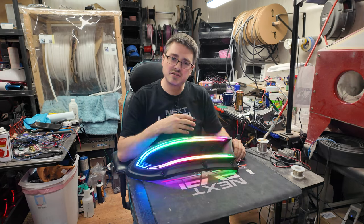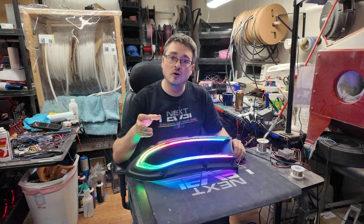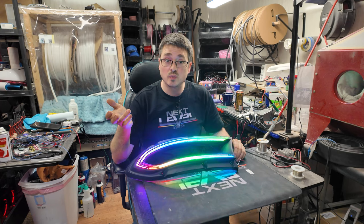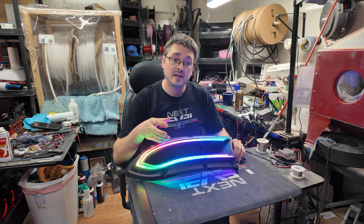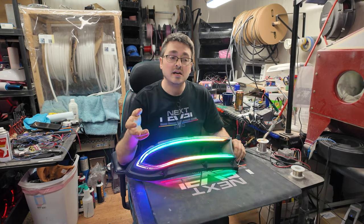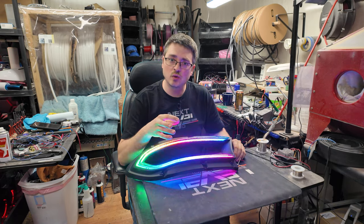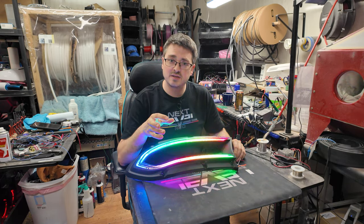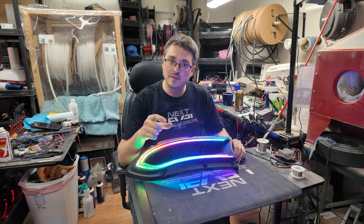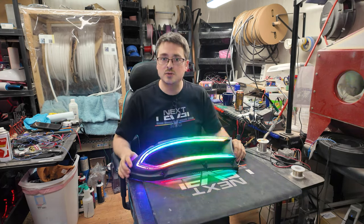I used to try to mess with the AGMs, the deep cycles and things like that, and just long term they did not hold up and they almost always died by the end of the show. Once I switched to lithium batteries, they hold up really well. And you can get a lithium battery for relatively cheap if it's not a high amperage battery. You have to consider it won't be able to start your car, but it can run all your lighting. So you have to put that on a different circuit or isolate that battery in some way so that it's not trying to start your car, but it could maybe flip a switch or something and run all your lighting when you get to the show. So, whatever case you have to do for that.